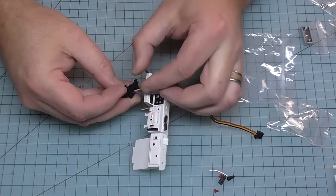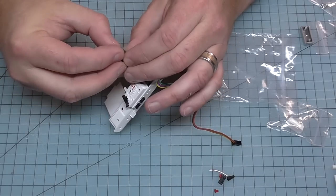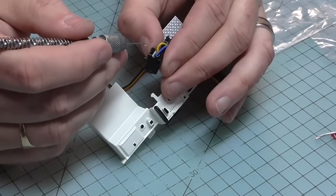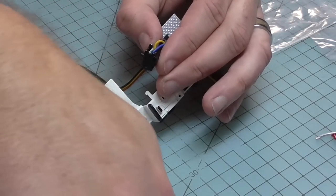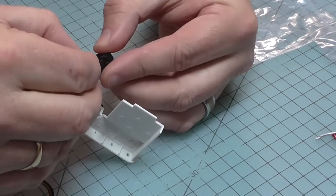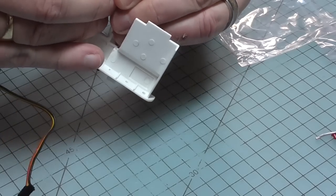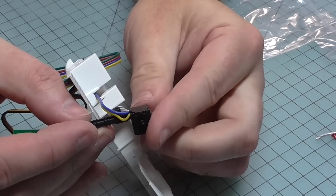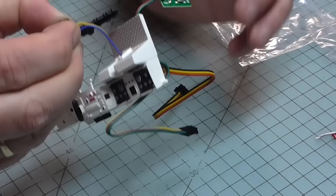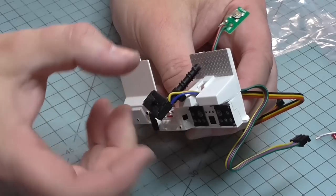Turn it upside down and put this into place - it will pinch the wires. They've got the wires coming out the side, so I'm going to put some glue around this edge here. There is a channel for this wire to go down on the other side, so I'm just going to line that up and get it in that channel. That will enable me to put the top section in like that. It's still up at one side but I'm pretty happy with how it is. That's going to lock that into place - just check that horn still works - no problems at all.